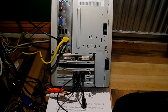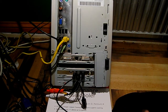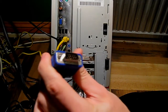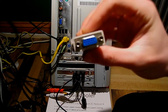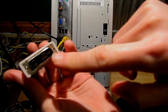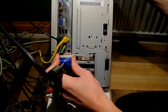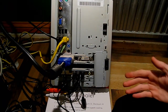If you look closely, you can see these are actually DVI-I sockets. Now, the monitor that I use on this machine actually has a VGA connector on it, but very handily in the box they supply an adapter — a VGA to DVI-A adapter. So you plug your VGA connector in the back. This is a DVI-A, but because this is a DVI-I socket, the A will fit in there because I is universal.